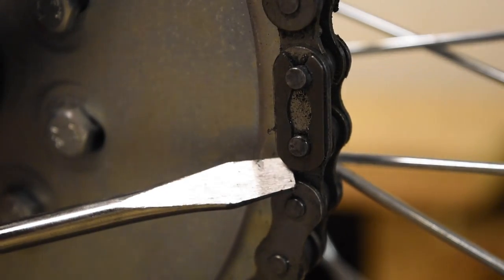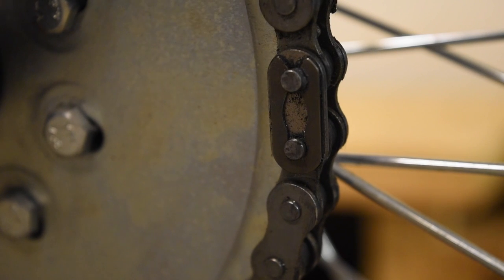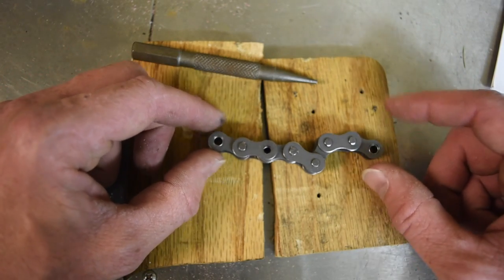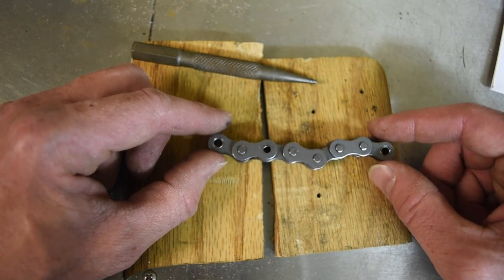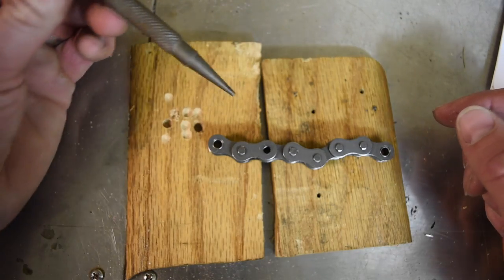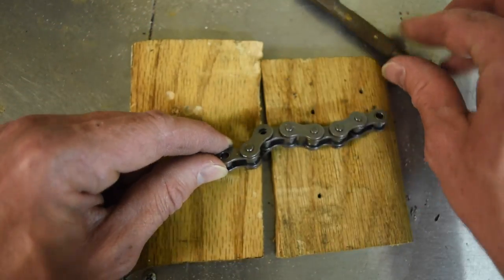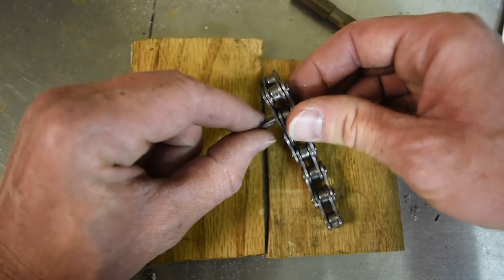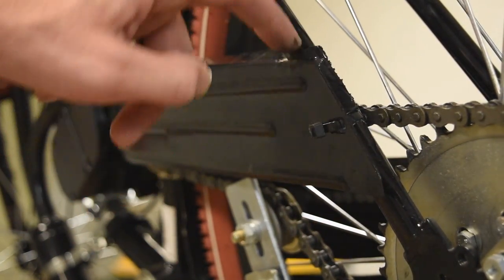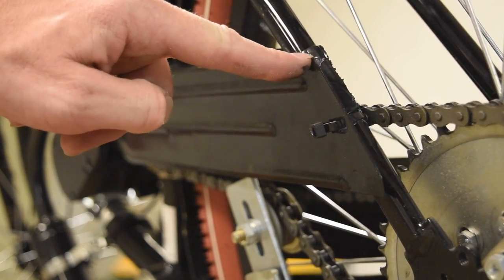The chain that comes with the bike is extra long so it will fit every bike. To shorten it, first look for the master link — it looks like this and you use a screwdriver to push down on the open end to remove the link. If I want to remove a link, once I remove the master link I go to one of the ends and use a nail set. I put it on top of one of these metal pieces and hit down on it to pop it out, then pull it out with pliers and the links came apart. The back side of the chain guard you just zip tie to the frame. I drilled an extra hole to keep it up and had to cut a little bit with a pair of tin snips.